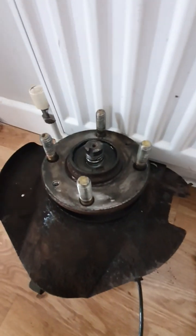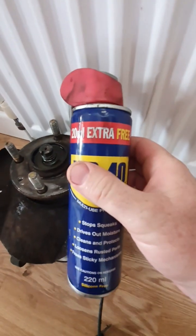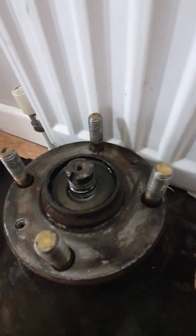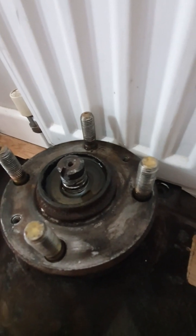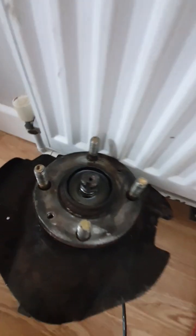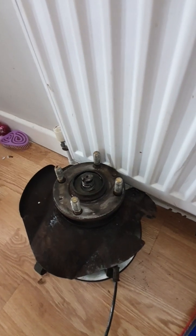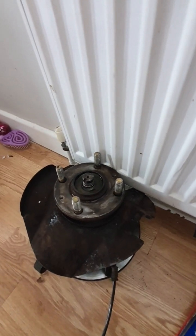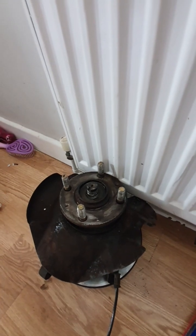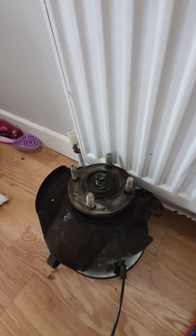So what I've done so far is I've left the hub and filled the bit around the hub nut with WD-40 overnight. The level has gone down a little bit, which means some of it hopefully has gone into the splines. I've also trimmed the drive shaft off because it was hemmed, so I can work with it more easily. Hopefully having softened off a bit, I'm then going to run the SDS chisel on it and see if that will push the spline out, because no amount of sledgehammering yesterday on that drive shaft end would get it off.